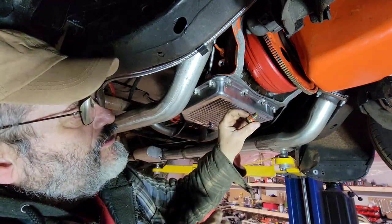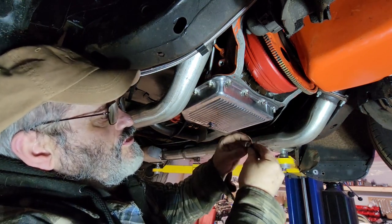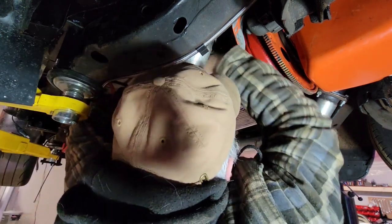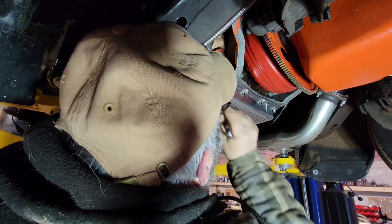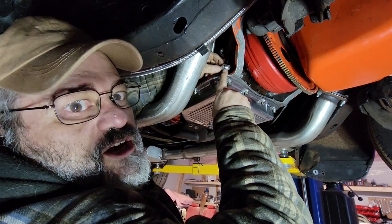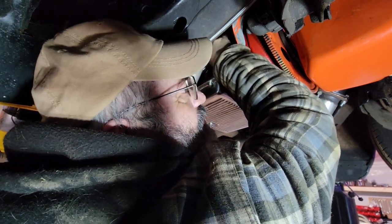You can see what they've got — it's just to protect the aluminum. Instead of having the flared line directly in the transmission, which could tear the threads out pretty easy, they put that in. This one had Teflon tape and then a big flat washer that seals it up. The new ones have a rubber seal instead of a flat washer and Teflon tape. That's my dipstick tube — I haven't got it attached to the firewall yet so every time I touch it it bangs.